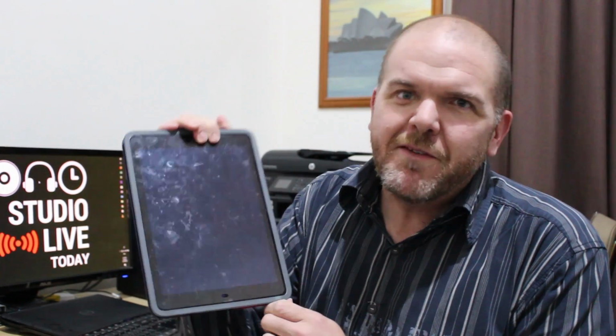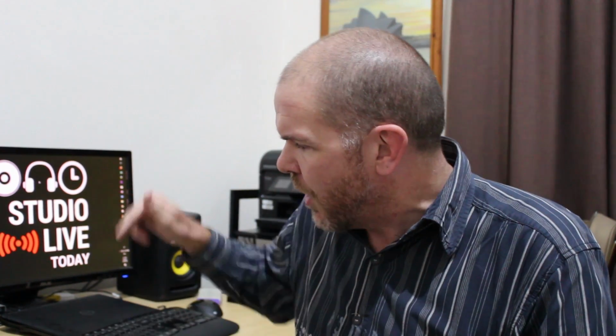Now, your mileage may vary, but I have tried this on a number of occasions, and I'm not even going to demo it here because when it does work, the quality I've had is terrible, and more often than not, it just literally doesn't work. So I won't go into a whole bunch of technical detail, but the way that the 4-pole adapter that the iPad and iPhone uses, the way it allocates all of the different inputs and outputs, is not aligned with a whole lot of conventional equipment. So unless you've got something designed for iOS, chances are it's not going to work so well. So maybe not go with this option.